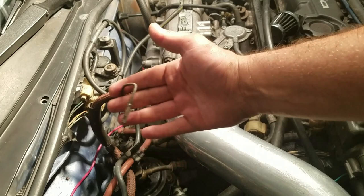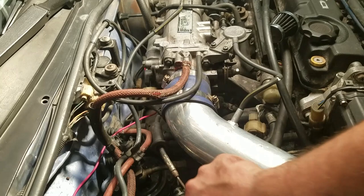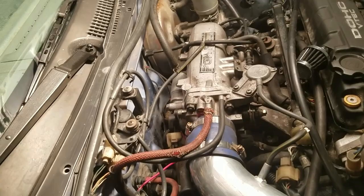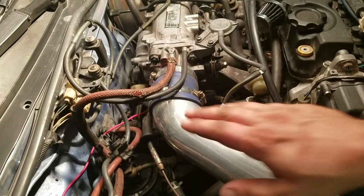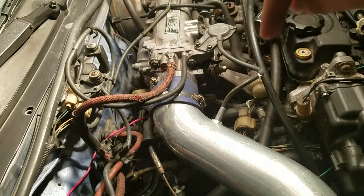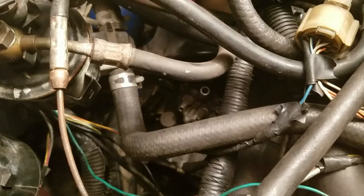On this one I just got it sitting right there - even when I did the swap I never pulled it out, I just left it in there. But it's already pulled out of the transmission and the boot is actually pulled back from the firewall already, so it'll be pretty easy to pull out once we get it disconnected from inside the car. I'm gonna pull off this intake real quick to show y'all exactly where you pull it out of the transmission. Most of the time it will have a little c-clip on the stem that the speedometer cable goes inside, and that little clip just locks in around it to keep it in place.